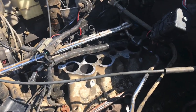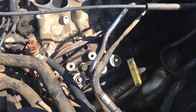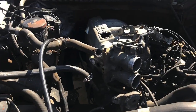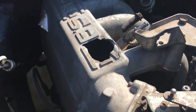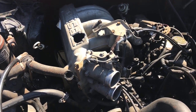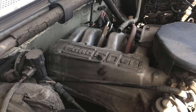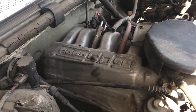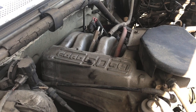Explorer. GT40 — I'm just taking a bunch of parts off it though. We do look fine in the 5.8s, but not with that. This is a 91, so again, not a hydraulic roller. I do like 351 though. 5-liter Ford truck engine — this one's a 96, so this actually is a hydraulic roller one. So if you want a hydraulic roller motor, it's a good start. Wish it was a 5.8 though.